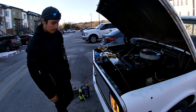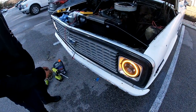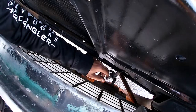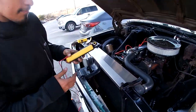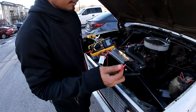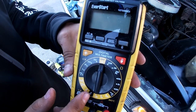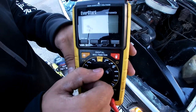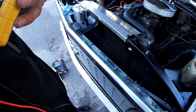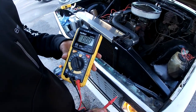We have to check which cable has power — as you can see, the turn signal is on and flashing. We're gonna look in here and see which one of these cables is the positive so we can connect the headlight to it. We'll use the multimeter, putting the negative on the chassis. We'll set the multimeter to 12 volts — if you have a good battery it'll read 12 volts or higher; a bad battery will read under 12 or 11.